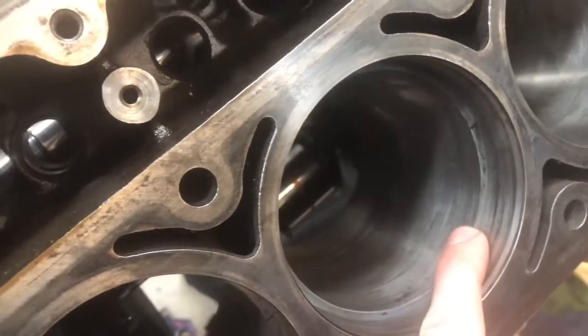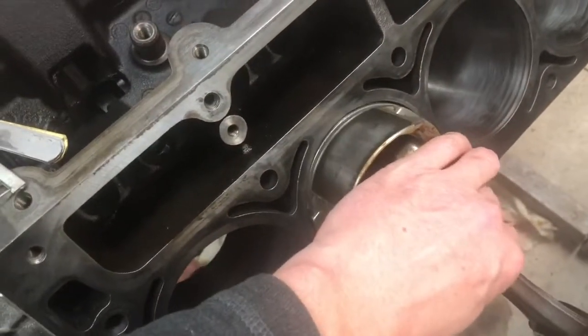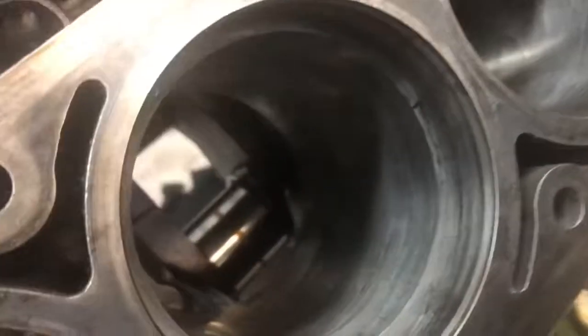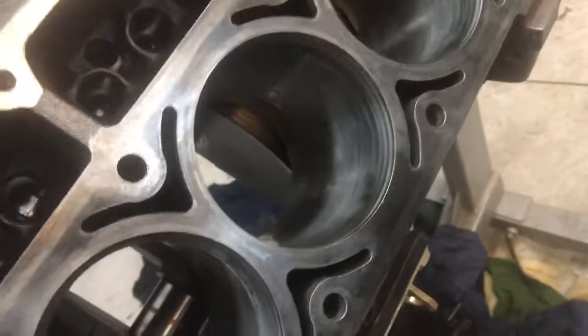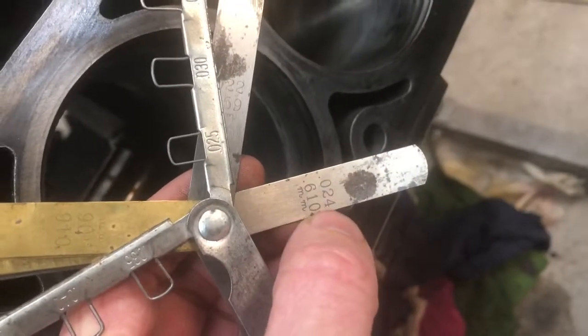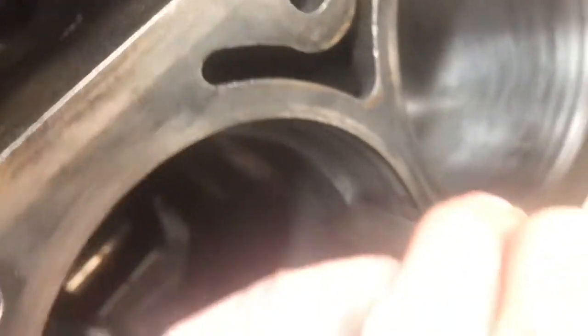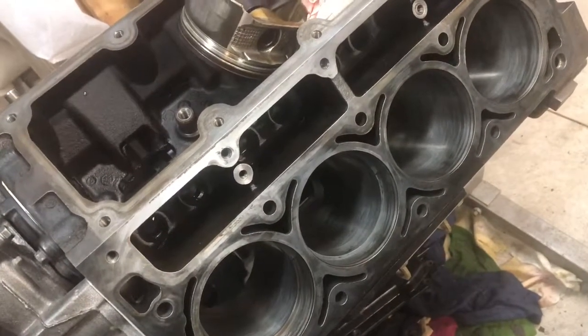So I bought a new set of rings, and this is one of my new rings. I just stuck it in the cylinder, just pushed the piston there so it's square in there. I was hoping that gap would be even tighter, but obviously my cylinder's got some wear to it. This one needs 24 thou, and it is pretty tight in there. So obviously I'm not going to grind any off. I'm shooting for 22 — they say between 22 and 25 thou is acceptable — it's at 24, so I'm not going to touch it. It is what it is.